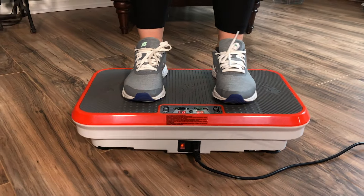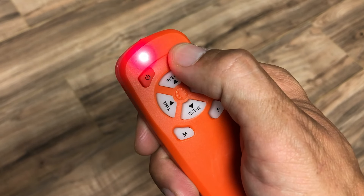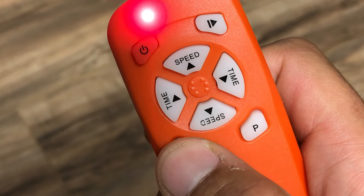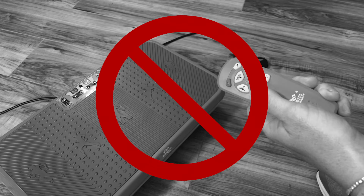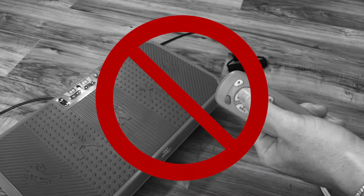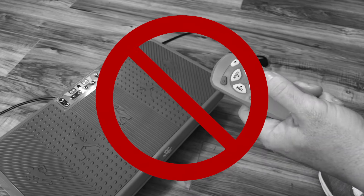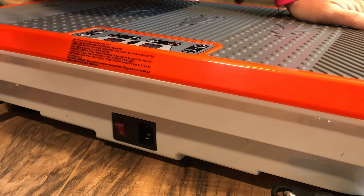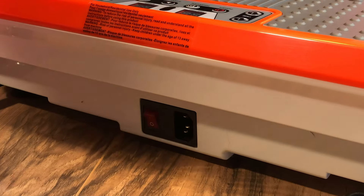To switch to manual settings, press the start-stop button at the top right of the remote to pause the unit, and then press the M manual button on the remote. Be careful not to push too many buttons before the unit reacts to the command — otherwise the unit memory will overload and the remote will not work. If this happens, unplug the unit for five minutes and then plug it in again. It will be reset.